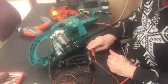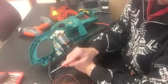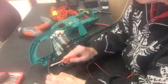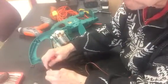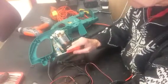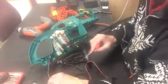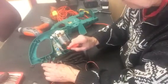Okay, so we've got the fuse to check, the mains lead to test for any shorts, especially around this part here, which gets the most movement. That's where they go weak, and they very often short out there. And then it's only a short length you'd have to replace in this. In fact, you could hard wire. You could put this straight into here. Forget this extension thing. Then we've got the barrier strip.